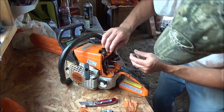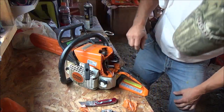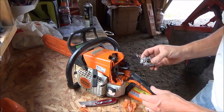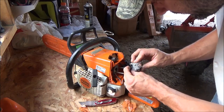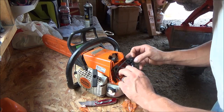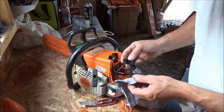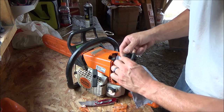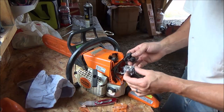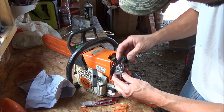Get this thing out of our way. This thing comes off. Right? Okay. Guess it's just a matter of working backwards. Now we'll reinstall our carb, hook our gas line up to it. Seems to fit quite well. Wipe off that. It's our evap purge line, our evap vent line, I guess we'll call it. And then, see how this little rigmarole goes over here.